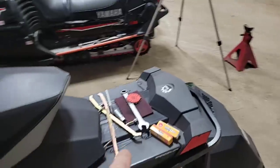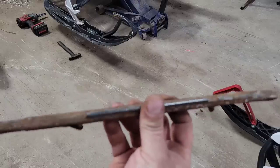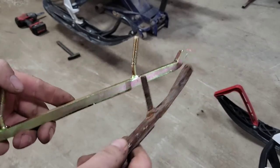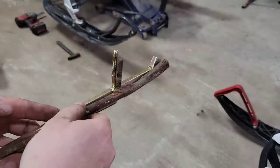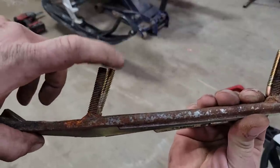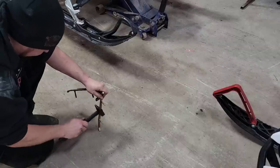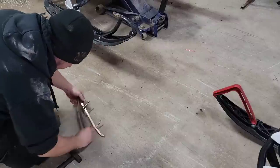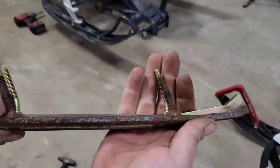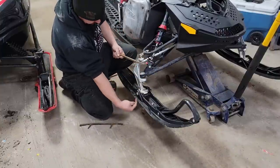We've got the plugs in with the black lines pointing to the injector — boots on, that'll be done. Picked up some new carbides from Cycle Salvage. The old ones I don't know what brand they were, but these new ones are Kimpex. They're slightly different — they've got hooks on the front and back, but one main difference is the angle the stud lines up at. So we just give it a little tap to bend them to match. A couple tip-tap-tippies and they're lined up. The studs are angled back to go into the skis — you can't put them in wrong.